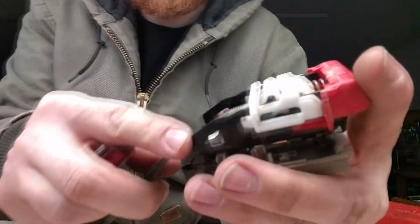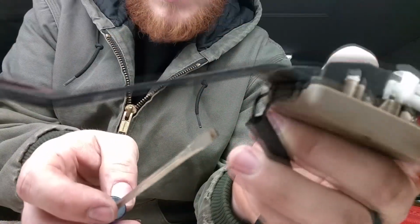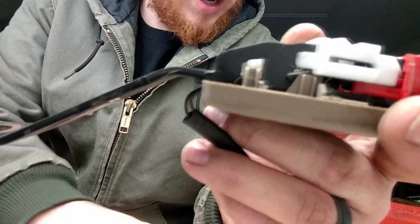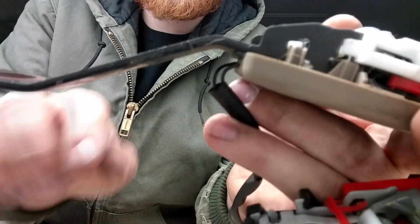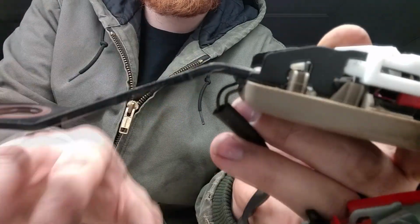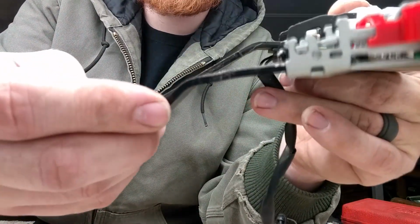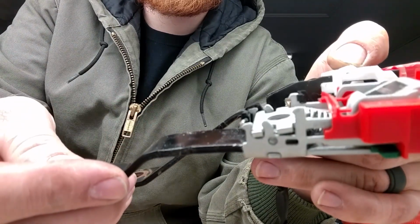Alright, now if I put it back on there and you review where it ends underneath of it, there's like a little steel step right there, you can see. Whenever I cut the Mitsubishi one, I'm going to cut it somewhere in this area. I'm going to take the Toyota one, cut it up here, and straighten this joint out till it's pretty close to straight. I want it to match that straight line of this. I'm then going to cut the Mitsubishi one somewhere in this area, and when they go together, the Mitsubishi one's going to bump into that notch back there. Yeah, it's kind of hard to describe.